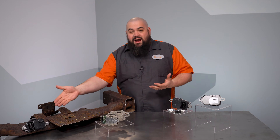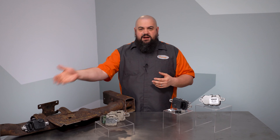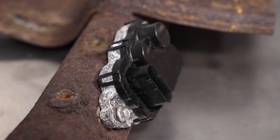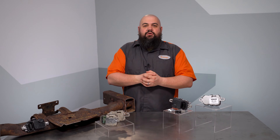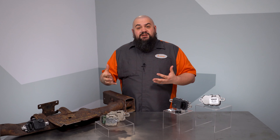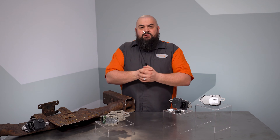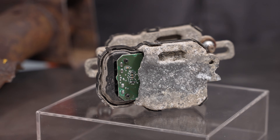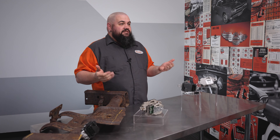Now the surface mounting is part of why these originals fail. We have sort of a progression you can see here. The first design held the module against the steel frame — the steel rusts, and then road salt, water, and oxygen combined with dissimilar metals to cause massive galvanic corrosion. We've seen these get so bad the back of the aluminum case rots right through and the circuit board is directly exposed to the elements. This one here snapped at the ears and exposed the delicate electronics inside. In some cases, they literally crack into it.